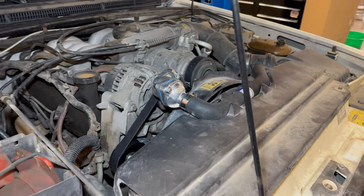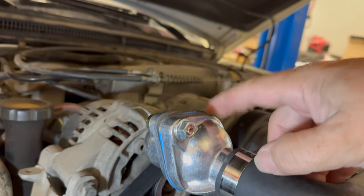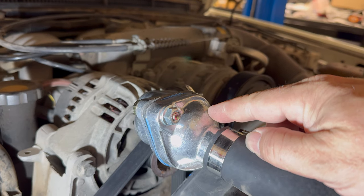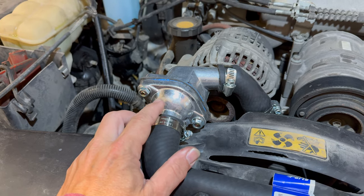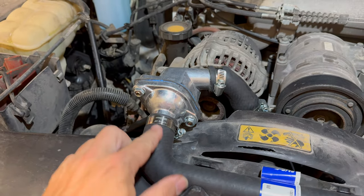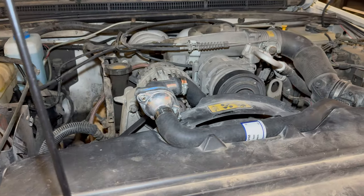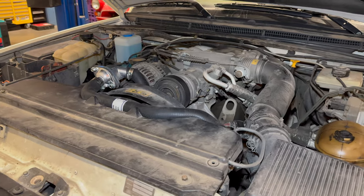Another bonus is you can put a standard thermostat in here in any temperature you want, making it easy to change for winter or summer, and you can order reusable thermostat gaskets from Inline Thermostats as well. This setup isn't the best-looking thing in the world, but it does clear the bonnet with plenty of room. There is a plug on the bottom — or you can order it with a plug on the top — that you can use for venting the cooling system, triggering an electric fan, or a temperature gauge. Just remember: if you're using it for a switch or gauge, you'll need two-wire sensors because this unit isn't grounded — it's only held to the engine by the hoses — so you'll need to run a ground wire to the housing. If anything does go wrong running this setup, I'll have a follow-up video. That's it for today — comment below and click subscribe.